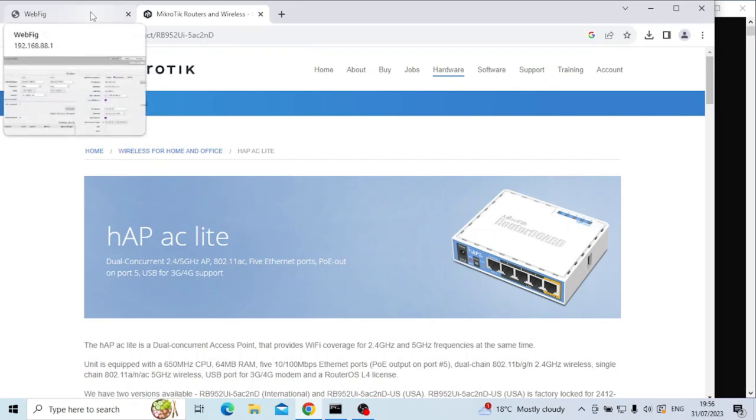First thing I'm going to do is reset this router — so this one I've just reset, these are the default configuration and default settings. What I'm going to do essentially is treat the default network as being one of my networks. In my scenario, often I'm on site, I'll be given one internet feed, I want all of the devices I'm looking after on a control network, and then I want a second network I can give away to other people that allows them internet access but doesn't allow them access to my control network — so two networks that are segregated from each other.